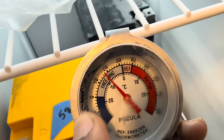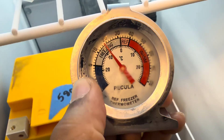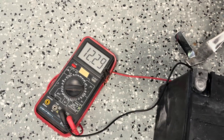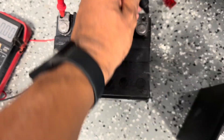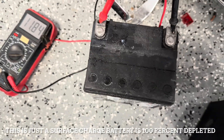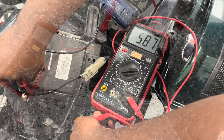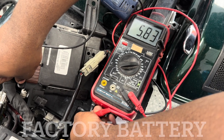Okay, it's just over 15 to 18 degrees in the freezer. Here's the battery fresh from under the seat at 12.29. Here's our frozen battery at 11.84. As soon as we put it on the bike and turned the ignition on, it dropped to under six volts and it won't even crank. No good for the stock battery.